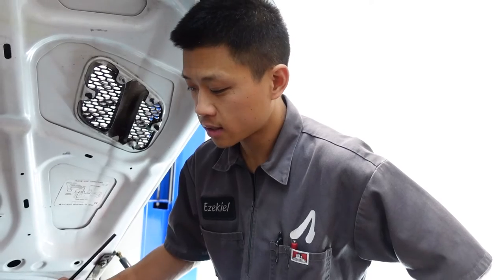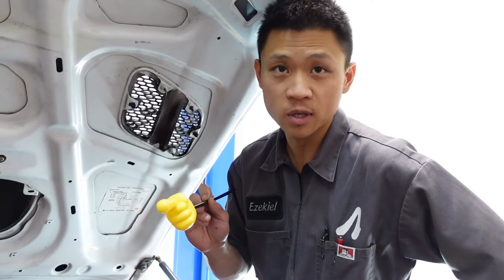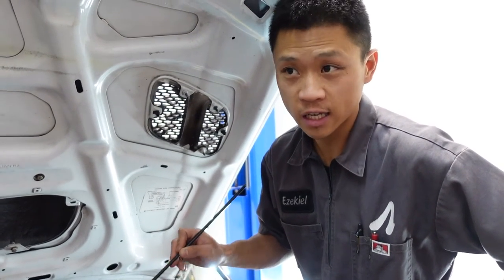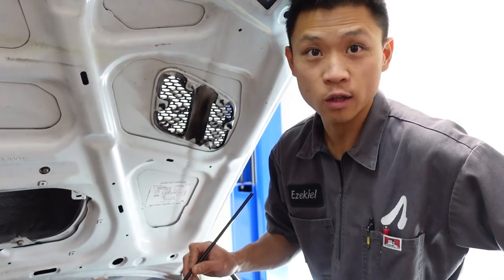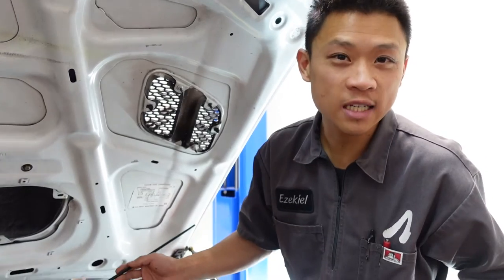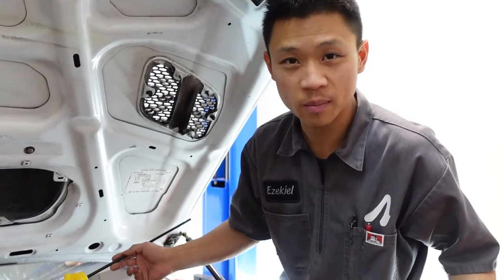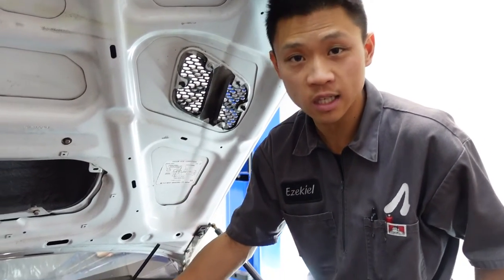So for some mysterious reason, even if nothing was wrong before, this can happen during a fluid service where the clutch master cylinder no longer wants to move any fluid. This was exactly our case — we replaced the clutch master cylinder and the clutch line. It's common for the clutch soft line to actually internally swell up on these chassis; it can look perfectly fine on the outside, but preventative maintenance. You probably noticed this is an RS 2.5, but it's actually got a STI six-speed swap in it, so when it got the swap it also got a brand new clutch slave.